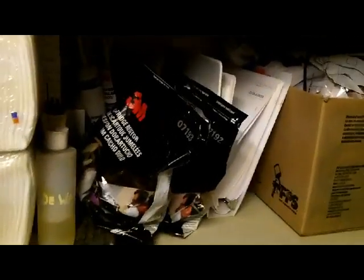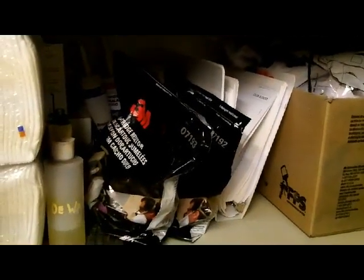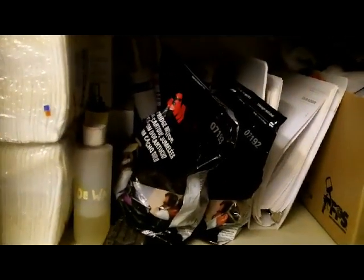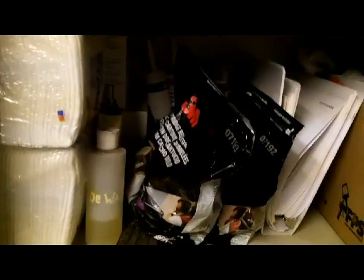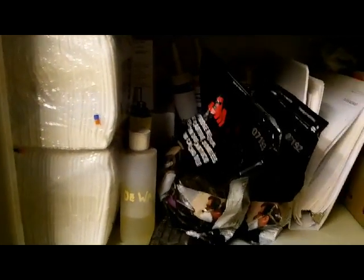Those last 30 days from the day you cut the seal on the bag. After 30 days, that respirator is done. Either demote it to sanding body filler or dust type applications. Do not use it for painting. Get yourself a brand new one, because the carbon filter in those is done after 30 days. Always store it in the Ziploc bag or a Tupperware or something so air cannot get in it, or it will be dead faster. You will know when it's dead because you will have a screaming headache after you paint.